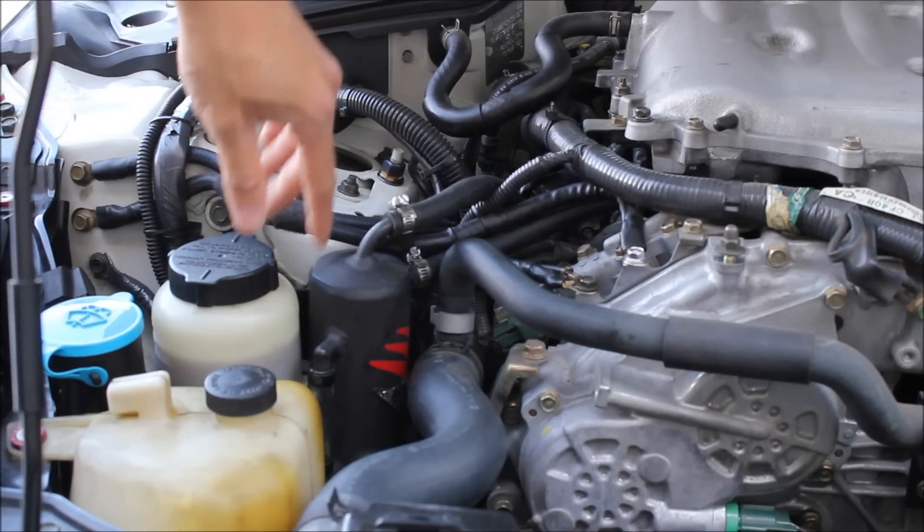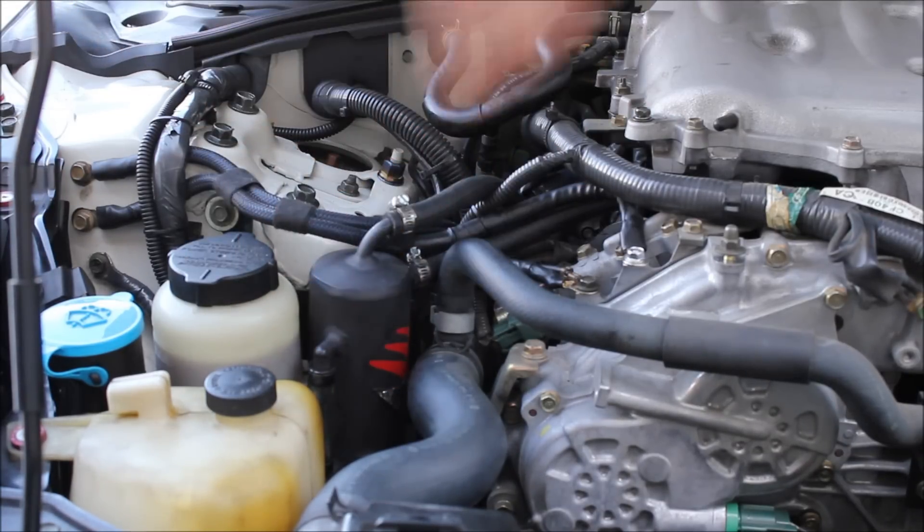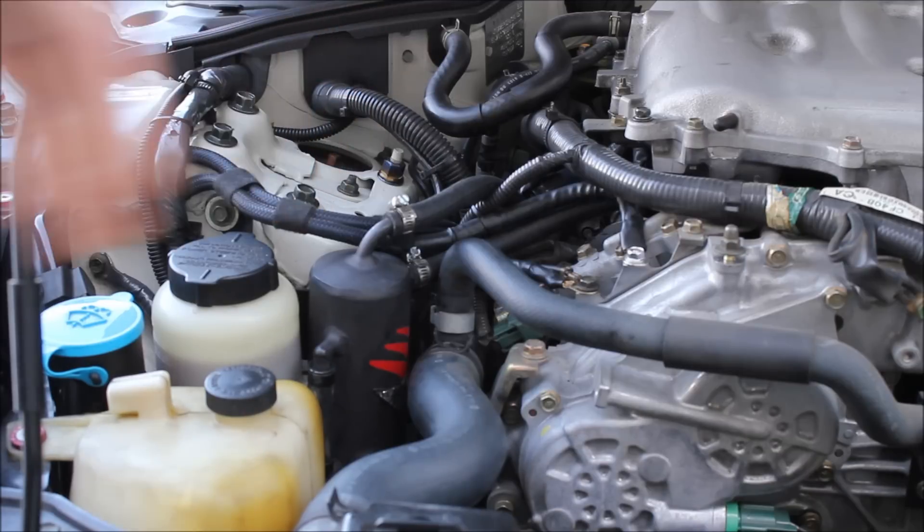This was the piece I installed, and I'm thinking it was either the elbow wasn't on tight enough, there wasn't thread sealant, or the coupler down low. It can happen when these things are put together by hand — or it could have been me, because I was readjusting it — and it was creating a vacuum leak.